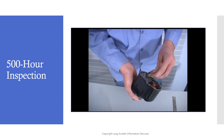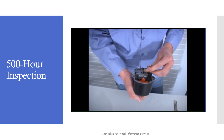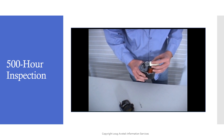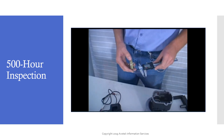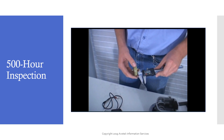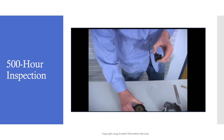Grease the cam and follower using a very small amount of M1827 grease. In the distributor housing, inspect the distributor gear carbon brush for wear. Check from the gear shaft to the end of the brush with a scale. The minimum length should be 1/32nd of an inch. If the brush is worn, chipped, cracked, or damaged in any way, then it needs to be replaced. Each of the bearings in the distributor block and bearing bar should get a small drop of SAE 20 oil.